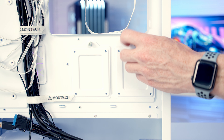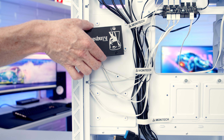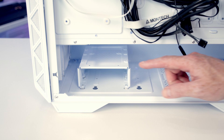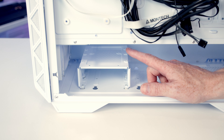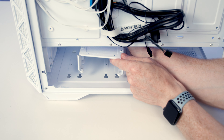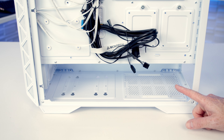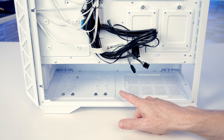In terms of drive mounting locations, we've got two dedicated 2.5-inch drive mounting brackets behind the motherboard, and you're going to be able to mount another two 2.5-inch drives to the rubber grommets towards the front of the case. At the bottom of the case we've got a hard drive cage which will accommodate up to one 3.5-inch drive, while on top of the hard drive cage you can mount either a 3.5-inch or 2.5-inch drive. The hard drive cage is movable and removable with two different positions. In terms of power supply support, the case is compatible with full-sized ATX power supplies up to a maximum length of 240mm.